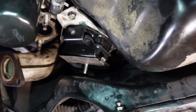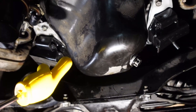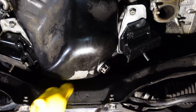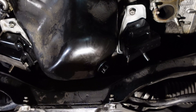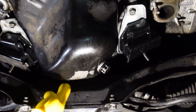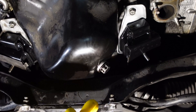Pretty much as high as we felt comfortable — we might be able to go a little bit higher, but the higher the better. Right here is our oil pan, and all the bolts around the oil pan are pretty easy to get to except the last four that are right behind here. It's generally covered by the subframe, so by jacking it up, you'll have enough space to get a wobbly extension or any combination of tools to reach the last four 10mm bolts in the back. The higher you get it up, the easier it is.